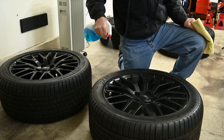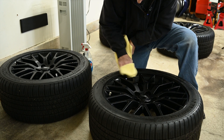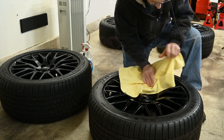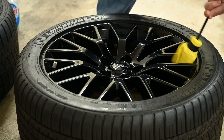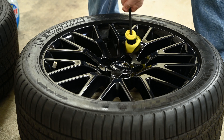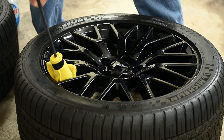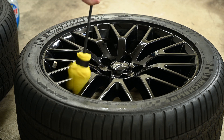After a quick wipe, I'm spraying them down with Windex to help remove any oils — and the Windex won't leave any residue on the wheels. My Electro Spinny Wheel Cleaner, which I showed you how to make in a prior video, makes super fast work of the cleanup. We'll be using it later too, to buff out the protective coating once it dries.